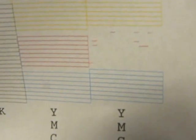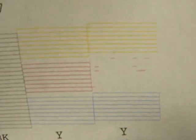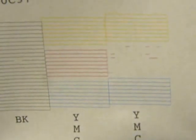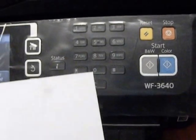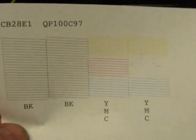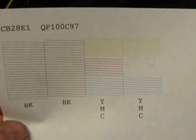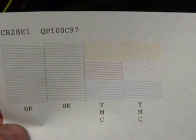I got a little bit missing in black, and parts of my Magenta were completely missing. If you were to install a CIS now, you might have a problem and then you'd think it was the CIS. This is a brand new printer, the Workforce 3640, but this applies to any of the CIS printers — you always want to run the nozzle check first. You can try doing one or two cleanings to see if that will come back.